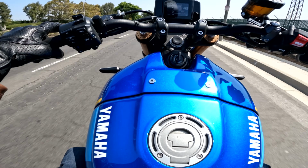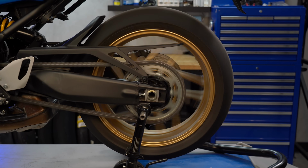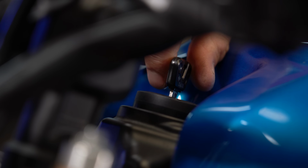If you've recently made a massive tire size change or you're rolling around on seriously underinflated tires, that could alter the wheel's rolling diameter enough to trigger an error. Similarly, if you just set down an especially long wheelie or you had the bike running in gear on a center stand or a rear stand, the ABS ECU might interpret that wheel speed discrepancy as a problem. Cycling the key ought to clear that up.